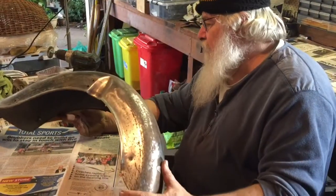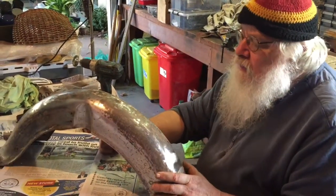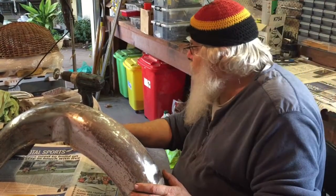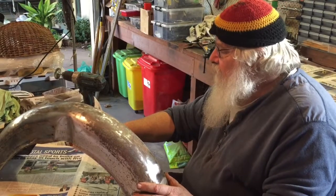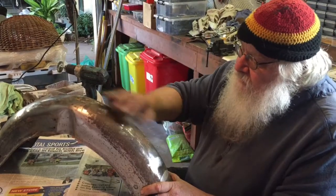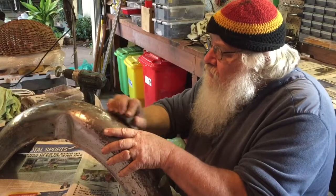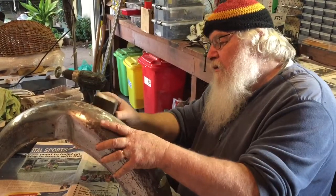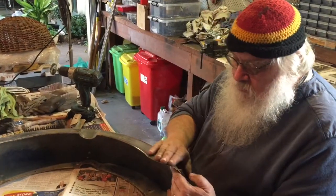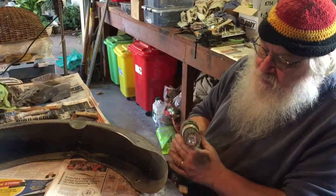On chrome you can use Coca-Cola and some aluminium foil, because aluminium foil is softer than chrome so it doesn't scratch it, whereas lots of the sandpaper stuff scratches it. You just use the Coca-Cola as a liquid to make it easy to sand. You're better off using Diet Coke because it doesn't have sugar — the normal Coke has got sugar and it gets very sticky.